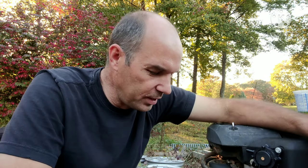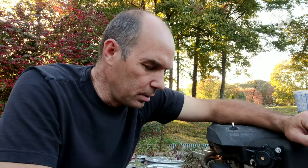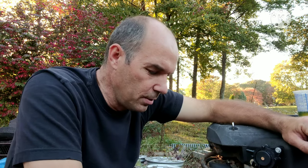This mower was having problems and when I put it into gear, when I engaged the blades to cut the grass, it would really bog down and have a hard time keeping up with the power necessary. It ended up being water in the fuel. But one of the things I tried was one of these Chinese pumps because I wanted you to see how bad they are — don't waste your time with them. You get three of them in a box but it's still not as good as the stock one. I'm going to throw the stock one back on and get this thing ready to go.